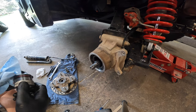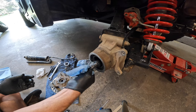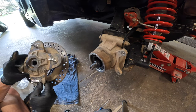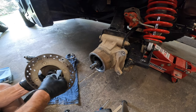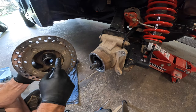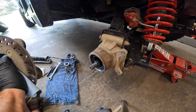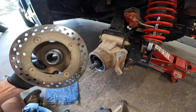Just wiping everything off — even though I'm going to use it again on the other side, doesn't matter. Wipe off all the excess and get it nice and clean. Now we're going to go back and grab our hub and clean this up. There are a couple of washers here, so pay attention — don't lose those. Hold your finger on them, flip it over, then clean this guy out. I'm going to try to keep all the grease out of those splines inside of there.